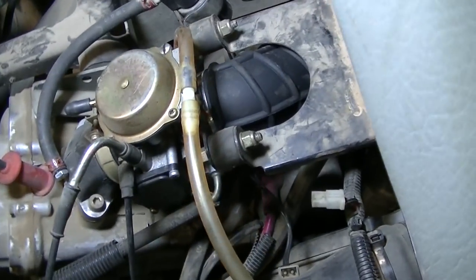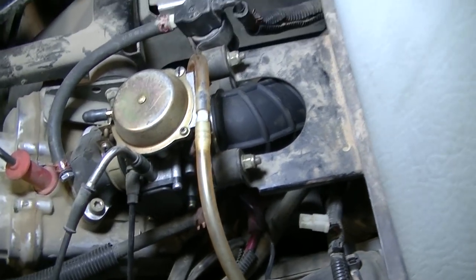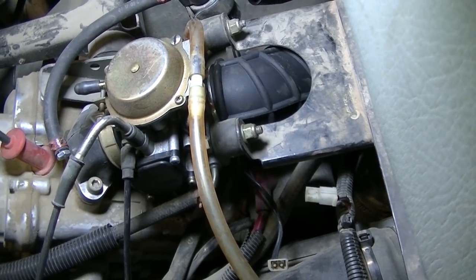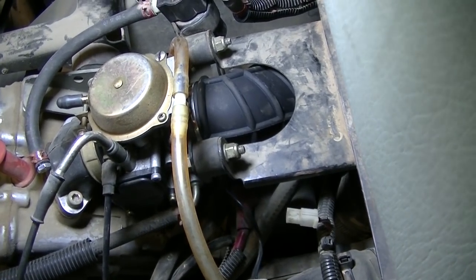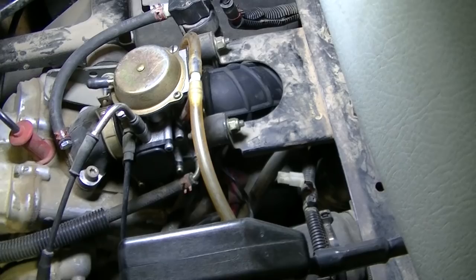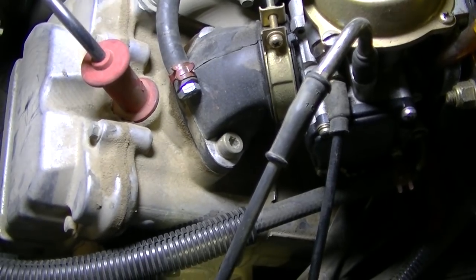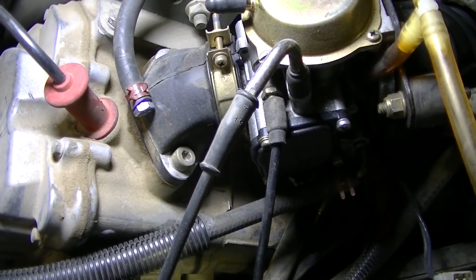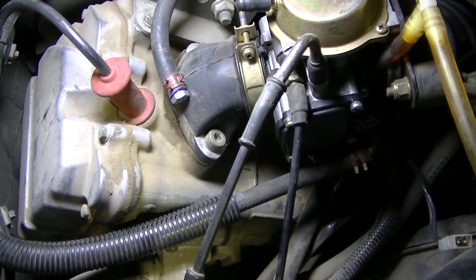I've got my new boot all installed. This really is an easy thing to do, and it's a critical thing to do. I would suggest that if you have an older Ranger like this, check your boot and make sure it doesn't have cracks. All the heat cycles it goes through — like I said before on the belt — the rubber does not last forever. It's also a good idea to check the intake on the motor too; those are known for splitting, and they split on the underside a lot of times, so you don't really notice. If that boot is split, the engine won't run very well.